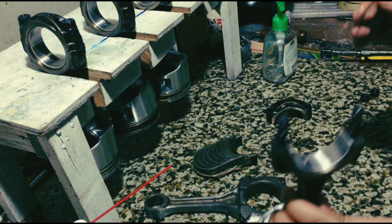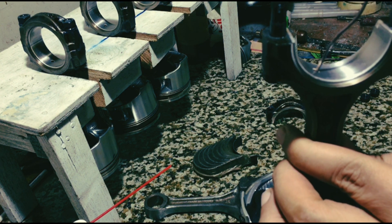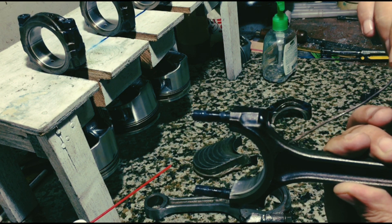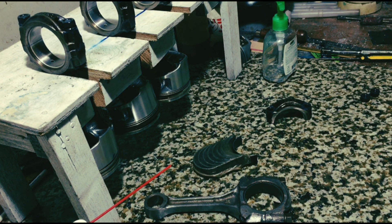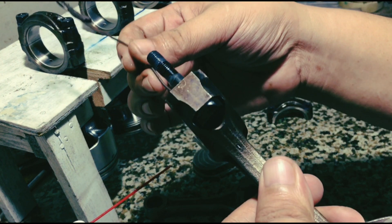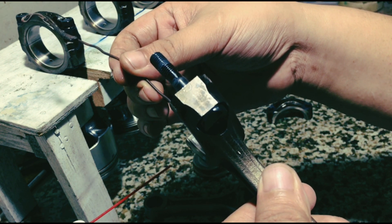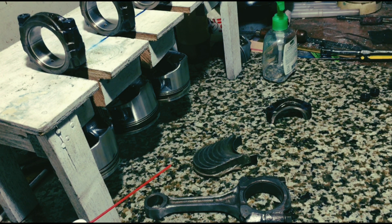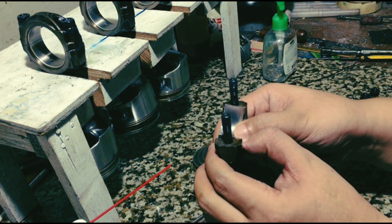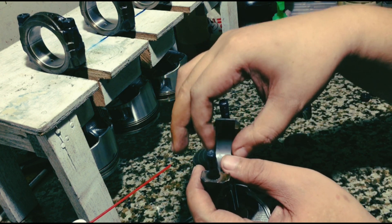You can see it goes through and through — let me show you with a wire. It squirts oil to underneath the pistons for further cooling. So when you think about it, the B16 bearings, while they fit the B20 rods, are not going to provide an oil spray underneath the pistons. If you put a B16 rod bearing, you're not cooling your pistons — you're going to start melting pistons. Then you'll insist the pistons couldn't handle it, go forged, and the bore will crack or scratch.